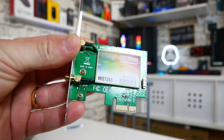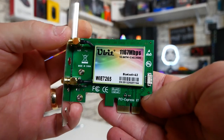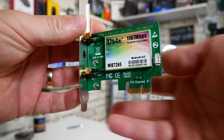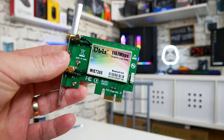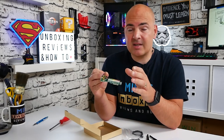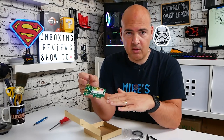Last but not least is the actual card itself, which is pretty tiny. This is designed to go in a full-width PCI Express port and uses the PCI Express x1. Ideally, when you install this, you want to install it as low as possible in the system. Some people will try and put it in the top slot, but sometimes certain boards will share resources with that top slot, so personally I would try and avoid that one. Do refer to your motherboard manual to see which slot is going to be the best for you. Being a relatively low-demand device, it is better to have it with a lower priority slot towards the bottom of the motherboard.